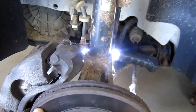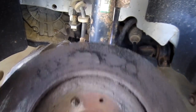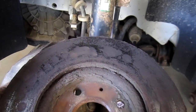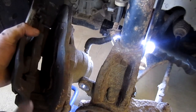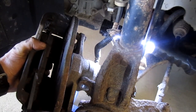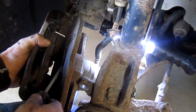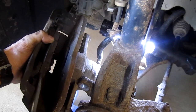Let's get this rotor out of the way and take a look at the back side — looks pretty crusty. Now let's look at the pads: the inner one is pretty much gone, but the outer one has a lot of meat left on it. That means something's sticking — either the caliper piston or these slide pins here. We're going to tear those apart and grease them up anyway.